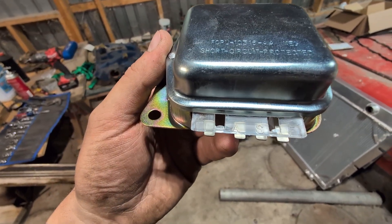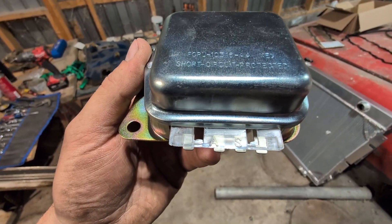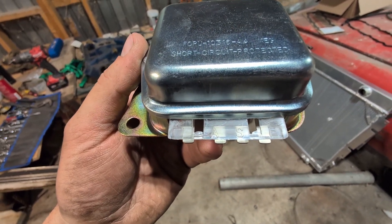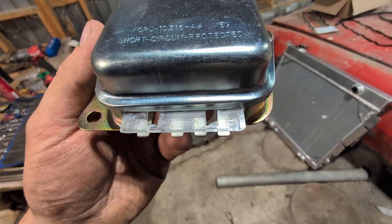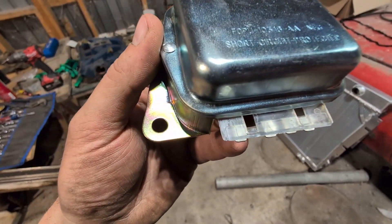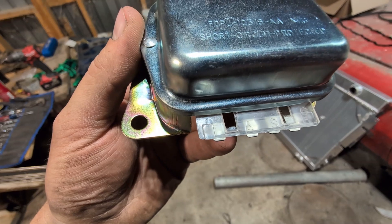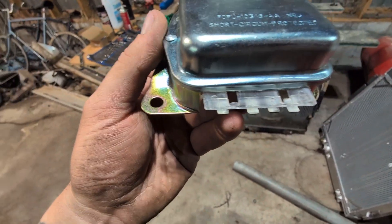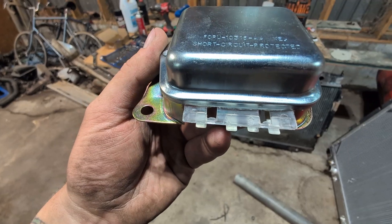The terminals you're jumping - I'm using one of these older voltage regulators that exist on old Fords, I believe all the way into the early 90s. The terminal on the farthest right side is F for field, and on the farthest left side - hard to make out but that says I for ignition. So you want to jump your field and ignition wire to bridge the connection.